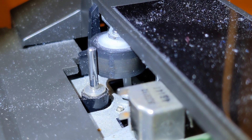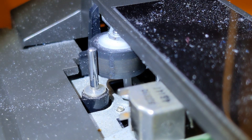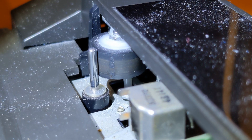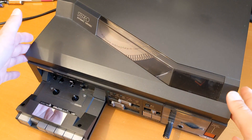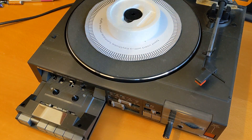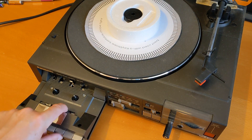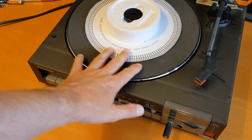I think what I'm going to do is replace the belt in this cassette deck. In order to do that I've got to take the transport mechanism out, and while I'm doing that I'm going to see if I can get to the pinch roller and replace that as well - but that will be in a future video.